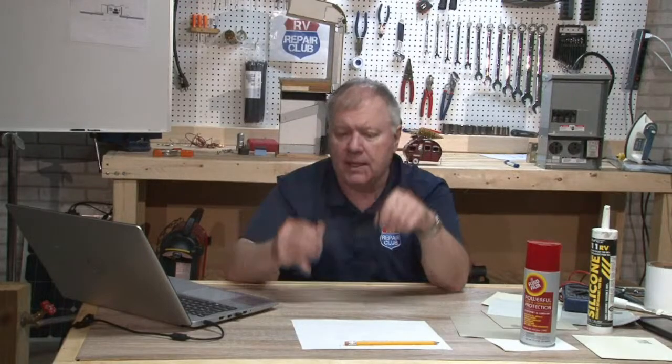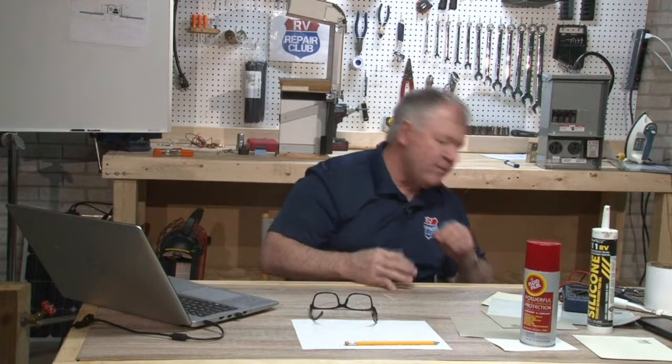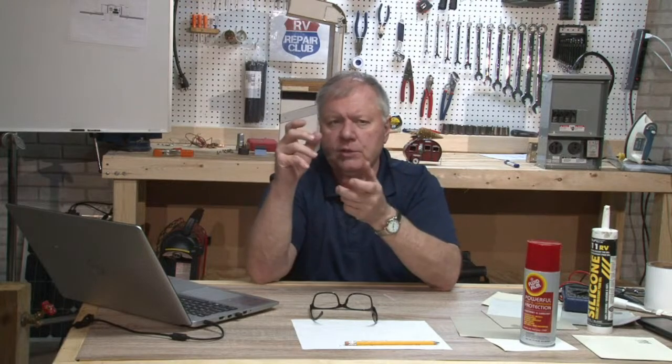Can you recommend a high quality tire pressure gauge? I don't have a brand name that I like, other than the fact that I go to the Pilots, the Flying J's. I've got a local place here that sells truck supplies, and they have a certification program. So I can buy a really good tire pressure gauge, the nice big long one. I don't think I have one here with me, I actually got it out in the shop. But two things I look for in a tire pressure gauge: number one, buy from a quality supplier that can certify it, so I can take it back and certify it. And number two, that it's got the adaptable tip. I don't mean adaptable as much as two different types of filling tips, so I can get it into the wheels that I want.